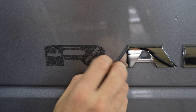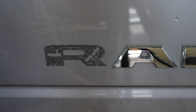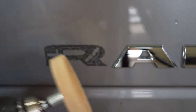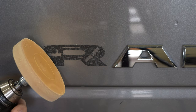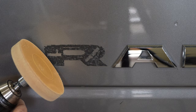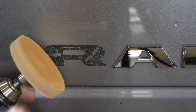Now I'm just showing you the R because I want to show you how easy it is — I'm not trying to waste your time. Now you've got your wheel. This wheel comes with an attachment to connect it to a drill. I have it on a Milwaukee. You don't want the speed to be too high. All you're going to do is come in here like this — it's going to leave a little residue because it's like an actual eraser. But then you just get some denatured alcohol and wipe it right off.